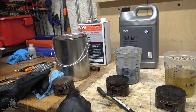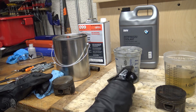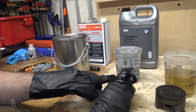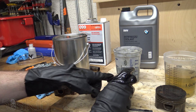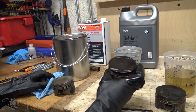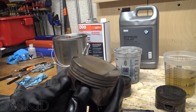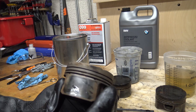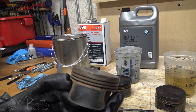Unfortunately, coolant — not so much. I wonder what did happen when I left that little bit of coolant in my cylinder. The piston was like this, there was a little bit of coolant resting down on the edge, and when I came out the next day the carbon was totally dissolved from the edge of that piston. I figured it was the coolant, but I guess not. If you like this video and learned something, please like and subscribe. I'm the 50s kid — thanks a lot for watching.